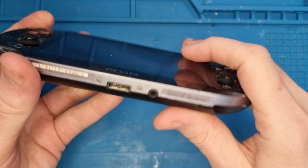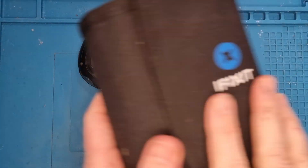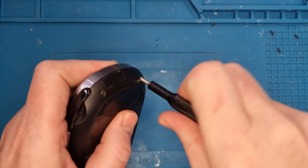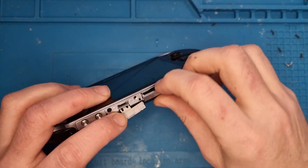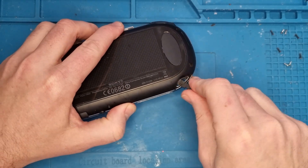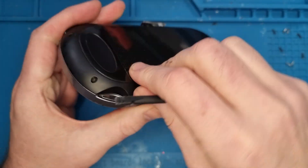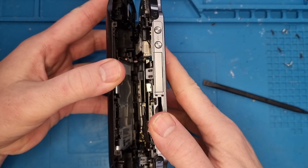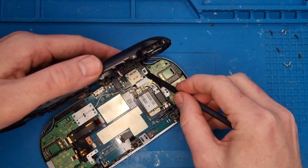This is when I thought a USB-C port mod might be the answer, so we need to open it all up. I'll get my iFixit kit out and remove all the Phillips head screws out the sides and out the back. There are a couple hidden away underneath as well. We take the card out and run a pry tool round the edges to prise it apart. You have to be quite careful because there are a couple of cables attached to the back — the battery cable and the rear touch sensor cable. We just lever them off.